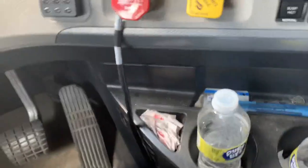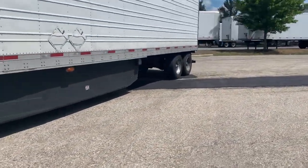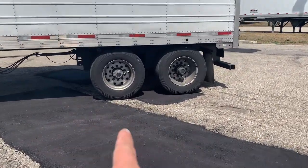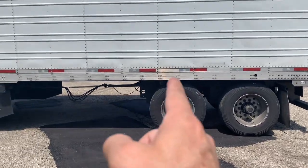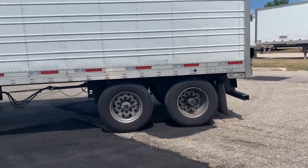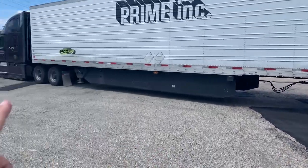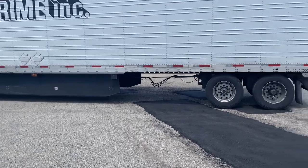All right, let's go check and see what happened. Now the wheels — if you notice — are all the way to the back. They did move. The wheels were in the exact same place before; I should have drawn a line on them. The trailer was back here and I drove the trailer forward but the wheel stayed still, therefore shifting the weight of the load. And when you go to CDL school you'll learn the weights: the front axle is 12,000, and 34,000 are allowed on each rear tandem set.